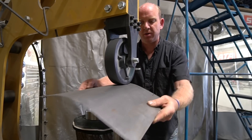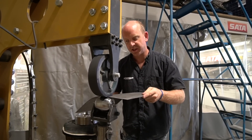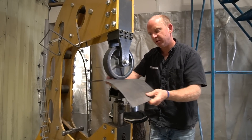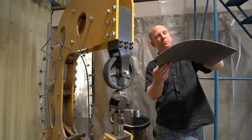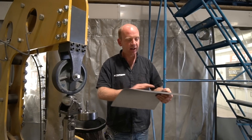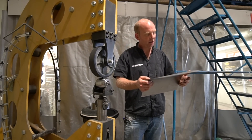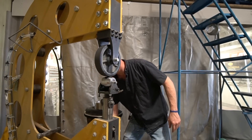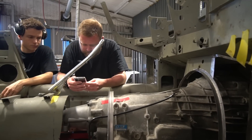You can generate a generic curve quite quickly with moderate effort, and then taper that curve easily if needed. It just gives the ability to curve a piece of steel in single curvature really quickly in a controlled fashion - a lot easier to set up with a lot less messing about than using pyramid rolls or slip rolls. Done very gently there won't be any lines in it at all. It's just a really neat way of making transmission tunnels, though Sam does it with a bit more precision than my speedy demonstration.